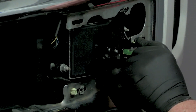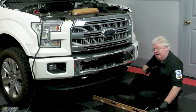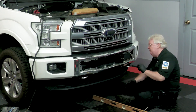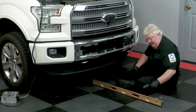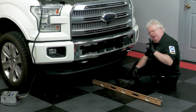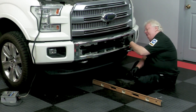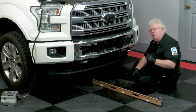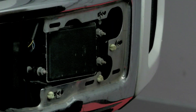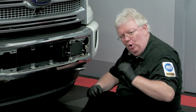That's right on the bubble — right in the middle. Now, Toyota for example includes a digital angle meter in their parts kit for ADAS calibrations. It's very similar, about this big — it actually looks like a small tape measure but it's digital. You turn it on, lay it up on something flat, and it tells you exactly how many degrees. Remember, we're looking for less than one degree of offset — whether it be this way or that way, less than one degree is our goal.